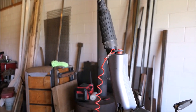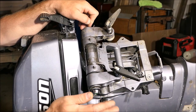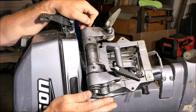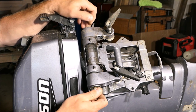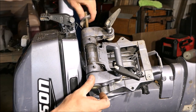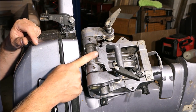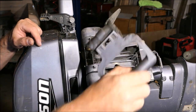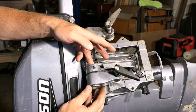Time to begin the process of changing to this steering system. First thing we need to do is prepare the engine to receive the cable. This is a 14 millimeter nut — I already have it loose and this bolt has to be removed. This is a spring-loaded handle; we can remove that now. There's two bushings here — we just need to push them out.